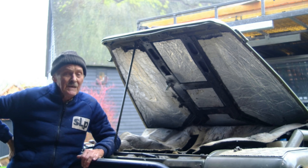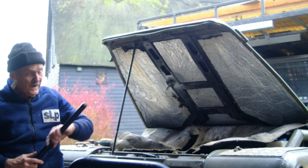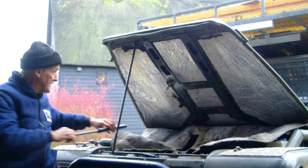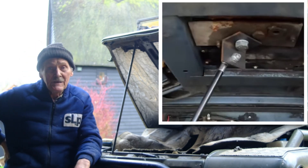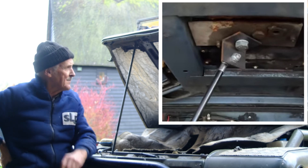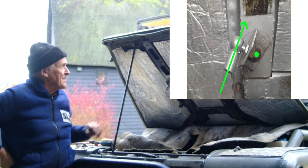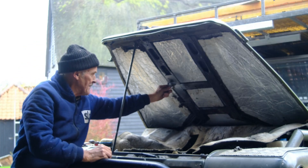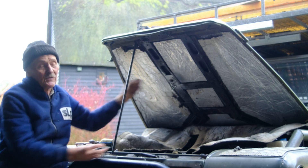So I did the analysis, selected a strut, and fitted it. I didn't pay too much attention to the end fittings and basically just copied what Benjamin Mikalev had done, which meant fitting the ball joint in a particular way. When I put the bonnet down, what happened was it flipped around, overstressed itself, and broke the end off the strut. Not good.